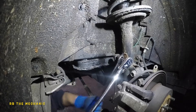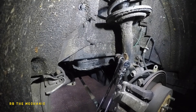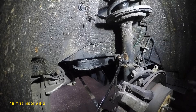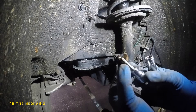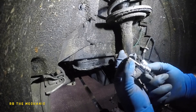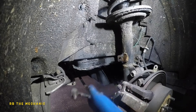Pretty easy once you prep it properly. If you don't put some lube on it and clean it, this is not going to happen. You see this - my allen key is twisted, but that's from a previous job. If you don't clean the threads, the whole tool's going to twist and bend, and that bolt is never coming out. Take your time - it only took me about two extra minutes to clean, lubricate, and let it sit.